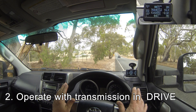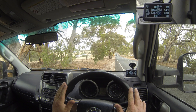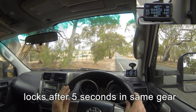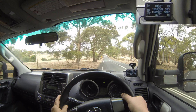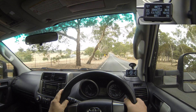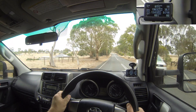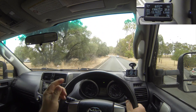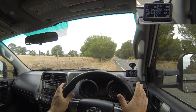The way Lock-Up Mate works when you're in drive is because the transmission's changing gears as you're accelerating, it actually waits for the gear change to stabilise before it then locks the torque converter. The transmission goes through the gears and generally it changes gear too early to maintain lockup from slow speeds. Once you get to the speed that you're after, it's now locked up. That's how it operates in drive.